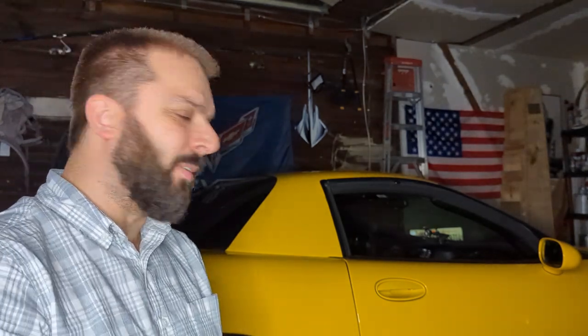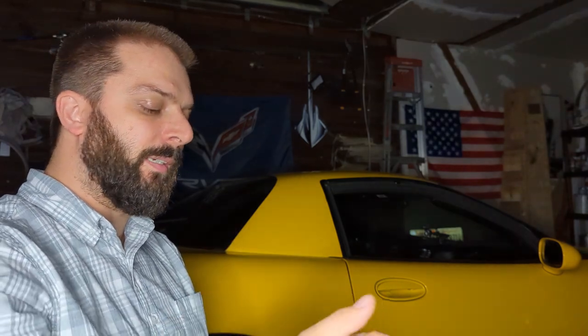So I feel like every week I'm always trying to dial in my transmission, how to make it a little better. Like again, I had an extension on my shift knob for a while. I just found out I just had air in my clutch system, and I'm really good at bleeding clutches. This one's just very unique. I ended up having to get a vacuum pump on top to get it out of the master cylinder. It was weird, but I got it all out.